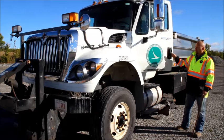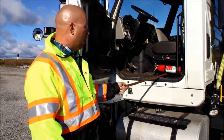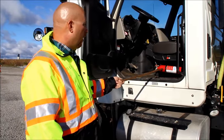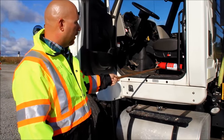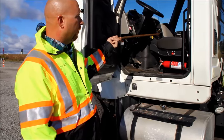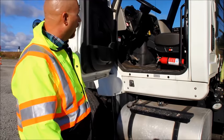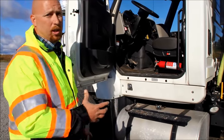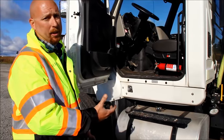From there, I'm going to open up the door. Before climbing into the vehicle, I'm going to point out my three safety items: one being the fire extinguisher, to make sure it is securely mounted, fully charged, and properly rated. I also have three reflective triangles stowed away underneath the passenger seat. I would also inform the examiner that I would have one spare electrical fuse for every size that this truck takes — though this truck does not take fuses, it takes circuit breakers.